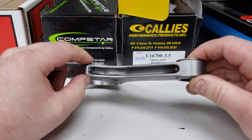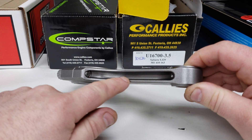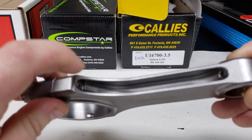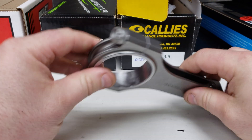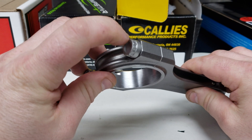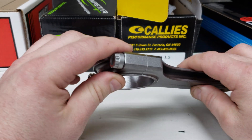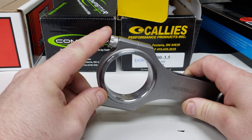Some cool stuff about this that you won't see on the cheaper H-Beams — down inside the H, they run like a double ball through here and there's actually a ribbed surface in there. That rib adds strength all the way from the bolt to the pin. This is pocketed out really well to shave weight. It's a Carrillo bolt — these are the upgraded Carr bolts. I really like the 9/16th head on these; it makes it really easy to torque because you can get a nice big socket on there. However, the bolt diameter is the same as the other rods, and if you have cases that have been machined a lot, this can cause some problems because it'll touch in some areas.